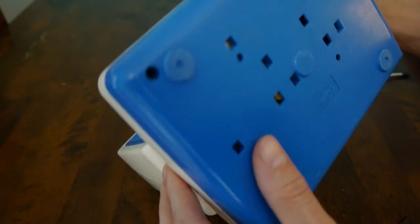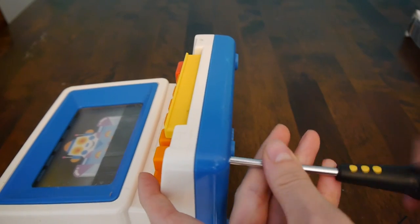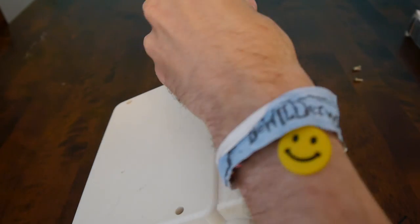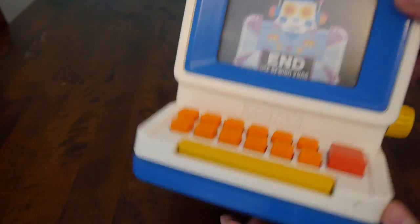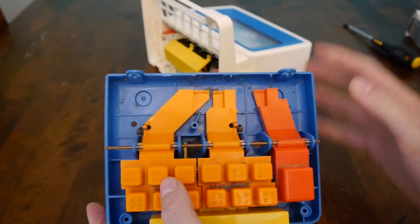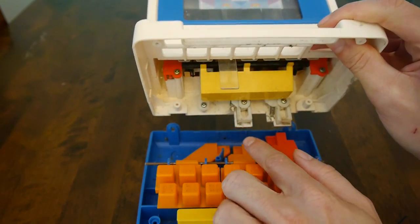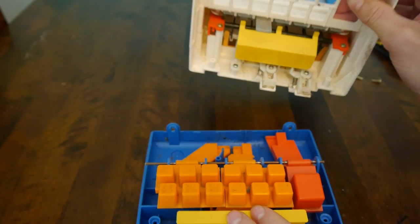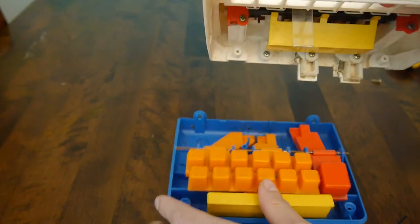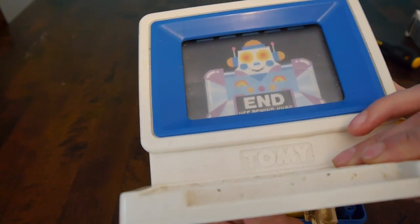Here's the Tomy Tutor Play Computer. We've got a few screws on the bottom that we will tackle first to find out exactly what is going on in here, and a couple of screws on the back — and the bottom does detach from that. So here we have the keypad section. As you can see, you press that down and that triggers that side, that side triggers that side, which then in turn triggers this switch — they both trigger the same switch here. The space bar triggers this yellow rocker inside, which triggers this acrylic piece here, and as you can see that pushes the sawtooth screen up and down — that's how you get the animation effect.